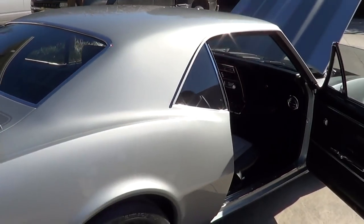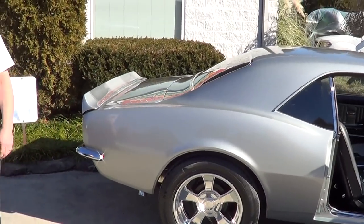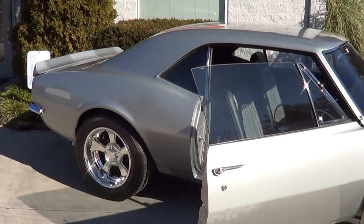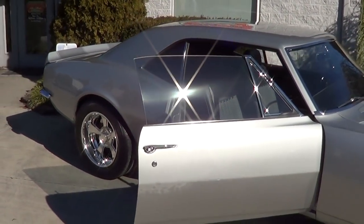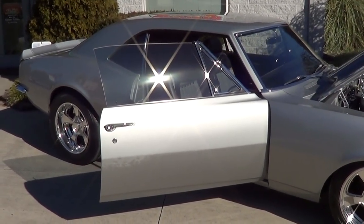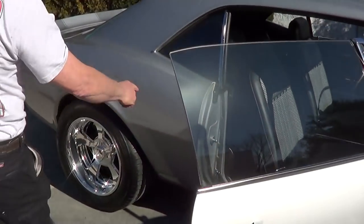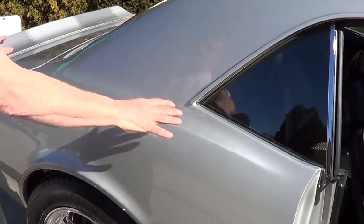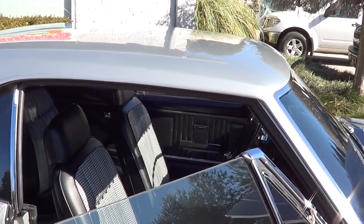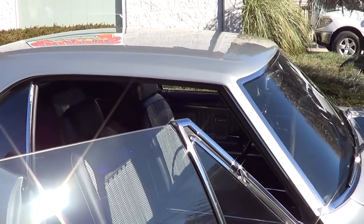Are you happy with the way it came out? Yeah, I'm pretty pleased with it, given what our goals and objectives were. It was a pretty solid car when you got it, outside of putting some rear quarters in it. Or am I discounting that? It was like a lot of Camaros. This car at one time had been raced in its lifetime, and somebody had put short quarters in through here and just shorted them, so we cut all those out and put new quarters. We skinned one door. We put one new front fender on it, both new wheel wells, new core support, new hood.